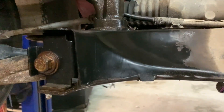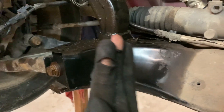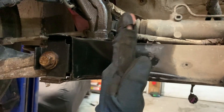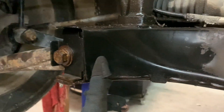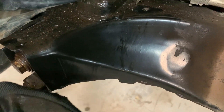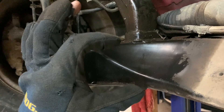We've got it all up on the ramp. I've got to come out until I get a flat edge and then triangulate it in, make sure it's all boxed. Then instead of trying to get my pipe to fit all these freaky angles on both sides, I've got a perfectly flat edge right here and right there, and I can put my pipe in there and weld it — makes it a lot easier. The pipe is about two and three-eighths inches diameter so I'll go to two and a half, just to have a nice round number. By this being tapered this way, the farther we get away from the flange the longer the distance is. I'll measure back until we're out about two and a half inches from the steel, and we'll have a good solid surface to weld the pipe to.